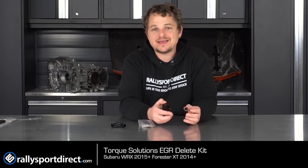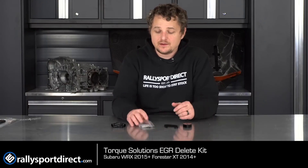It's nice that there are kits out there like this that just make it kind of plug and play. Installation-wise, it's not the most fun I've ever had — it's tight up in there. I remember taking off the intake manifold and dealing with coolant. It's not something that is particularly difficult, but it does take a little bit of time, and I would recommend having a buddy there to help you out. Give yourself two, three hours to do it. Have this kit with the gaskets, and you should be able to whip it out in an afternoon.